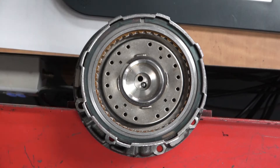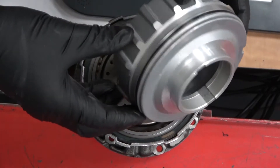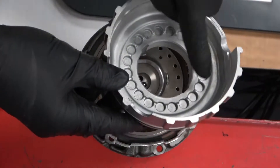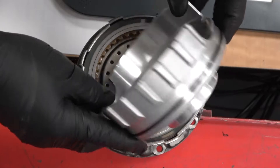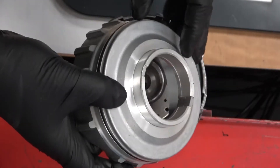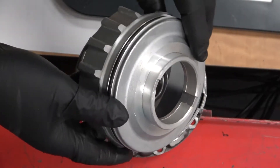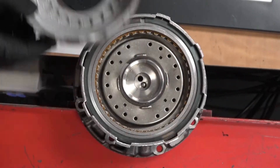We're going to use air today. There's a passageway over here on the side. There is a piston that sits down inside here. This is not the actual piston, but something similar — where you have a flat surface, there's a spot for return springs, an oil seal on the outer edge, and an oil seal that fits on the inner edge. Hydraulic pressure comes up from the bottom and pushes this upwards.